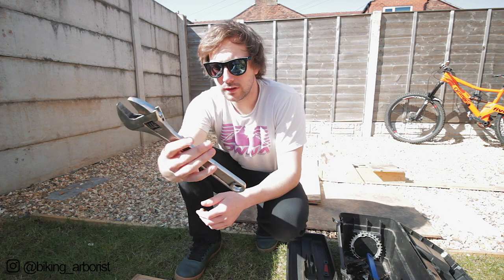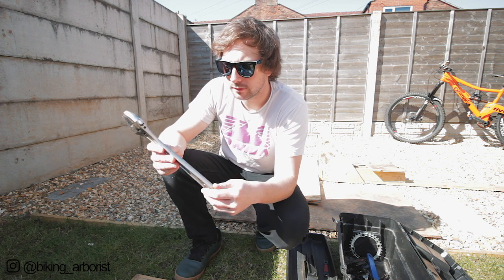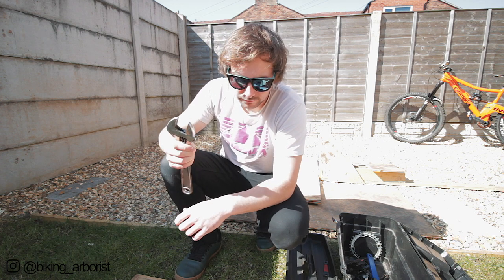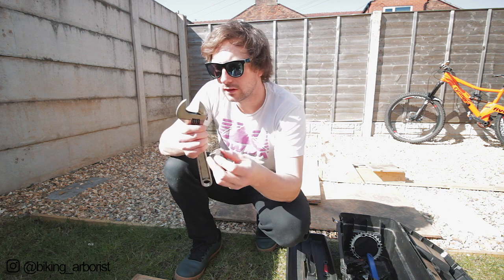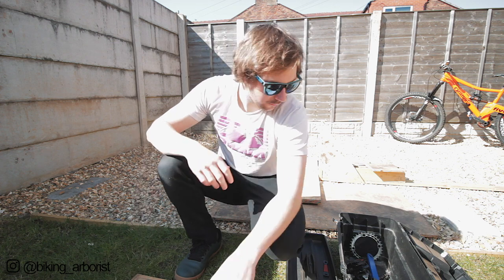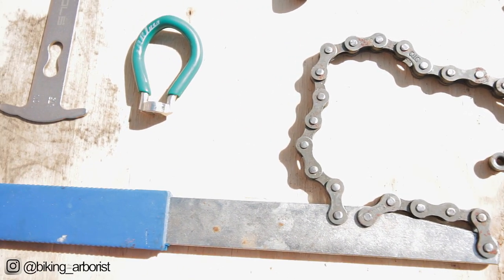I've got a large adjustable wrench - this is probably a bit big, you could do with a smaller 10-inch one as opposed to this which I think is a 12-inch. The reason I have this is for anything I can't use the spanners for. The main thing I use it for is as a cassette tool - if you want to get a cassette off, I'll just use this. To use the cassette tool you'll also need a chain whip, which is this. These are super cheap. It means you can get your cassette off and, more than anything, clean behind it, give it a good degreasing. Other than that you don't need to take it off unless you're actually changing it.